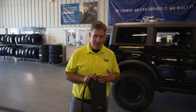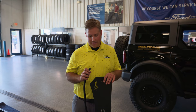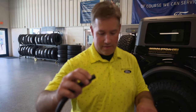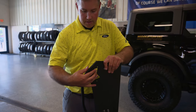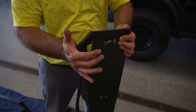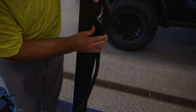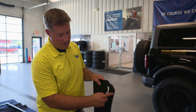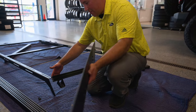Next step is the wind deflector. We first started by test-fitting the hardware and making sure it actually tightened on the rail. It does bottom out, but it does tighten up where it's not loose. So we took it back off and now we've got to put the seal on it. This foam part — we want to make sure that goes towards the body. We're going to start on this corner and push it on, and it'll just press fit all the way around. Just make sure you get it fully seated. We've got the weather stripping on there — start about halfway between these two points and it ends up about the same on the other side.